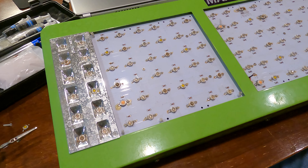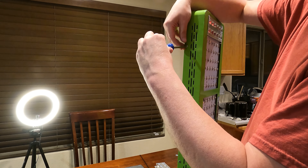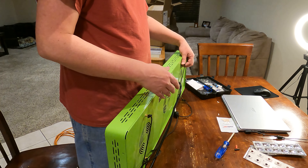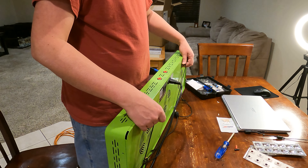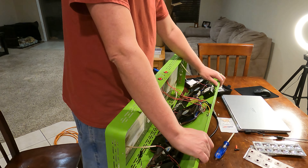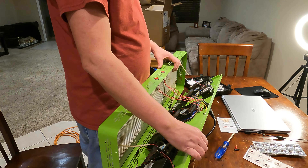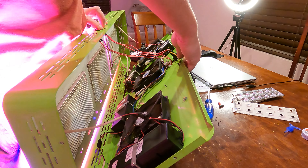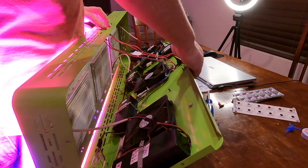To get to the drivers I've got to remove about 12 screws on this whole thing. Now we've got the screws removed and I'm ready to take out the back. I need it plugged in for this test but I need to be very careful not to touch any of the AC current. I'm going to check the fans real quick to make sure they're all going. Turning it all on - I definitely have a fan issue. This fan over here isn't moving whatsoever.